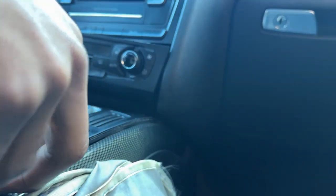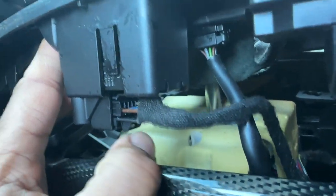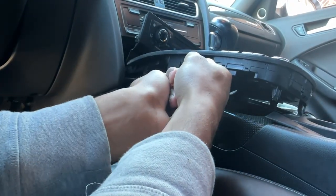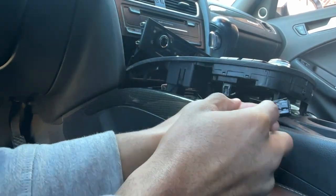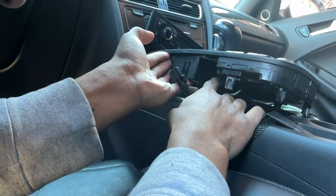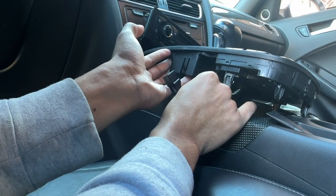All I'm trying to do is get this MMI control to lift up a little bit more. There are actually two more wires — for this one right here there's a little tab at the bottom, simply push that up and it should pull right out. A word of advice when you're working on these Audis: there's always a kind of lock on the connector, so never just pull anything out. There's always a little latch on there you have to push down — that'll save you a bunch of money. This one will be the same thing, a little push tab at the bottom — just slide that in and pull straight out.